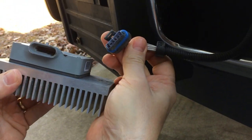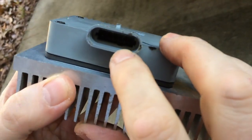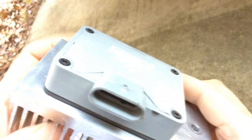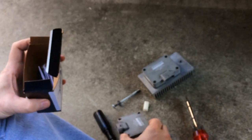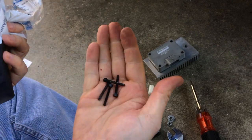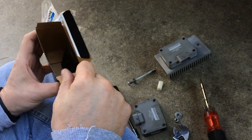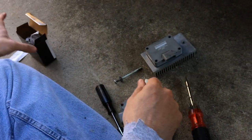It has a different kind of connection and a different kind of resistor inside. There's normally a resistor that sits in here, and there's a different one calibrated at the factory at the time your vehicle was originally put together. They don't come with a new one, so you have to transfer it from the old one. When you pick up a replacement part like this, it'll come with a set of new Torx screws and a new insulator pad used between the pump-mounted driver and the heat sink.